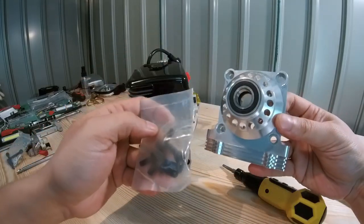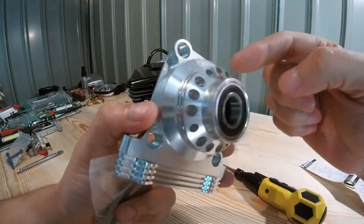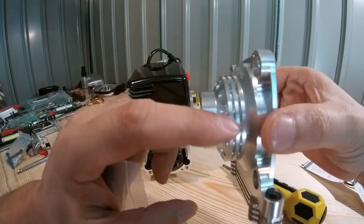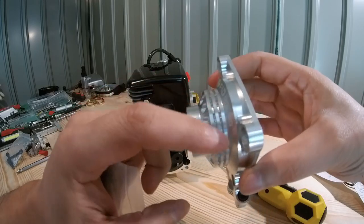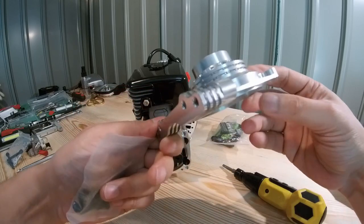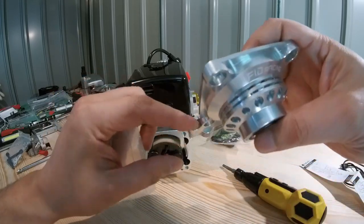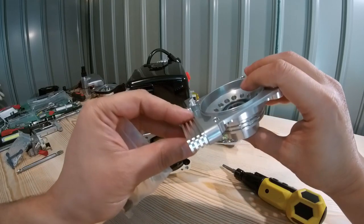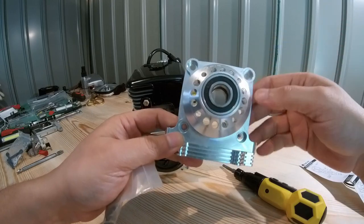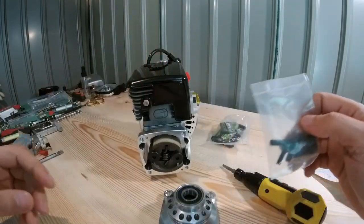So this is what comes in the packet - look at all the drilled holes for cooling, that looks amazing and it's finned as well. There's a lot of work that's gone into this. I really appreciate precision engineering - it's one of my favorite things. It's a split clutch as well, so you can take this bottom half off. That's amazing - it should make removing your engine a bit more easier.